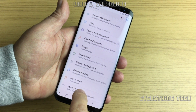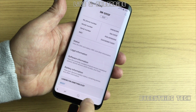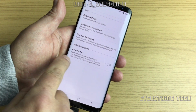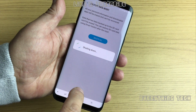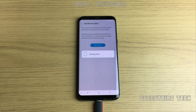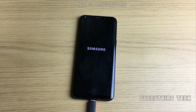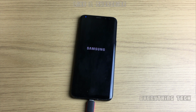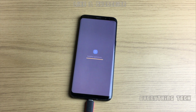So in order to correct this, we need to reset the phone to factory settings in order to reset everything properly, because we didn't reset because we installed home CSC, and that keeps the data that you had there before. Although there was no data for me, it kept some of the settings that were there before when you installed firmware 7, which is the factory binary. So once the phone restarts, this is sped up 2000%. Because it takes such a long time. You will be here at least 20 minutes to install everything and to make sure that everything is checked out and it's installed properly.